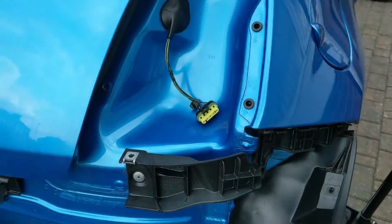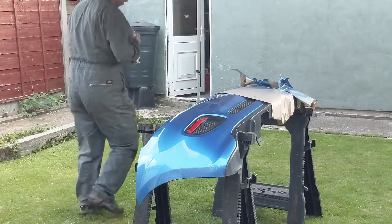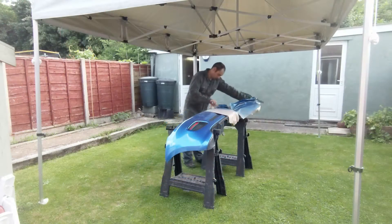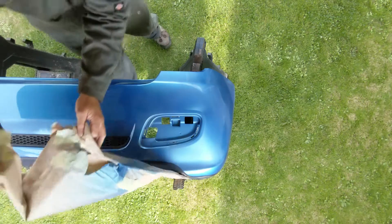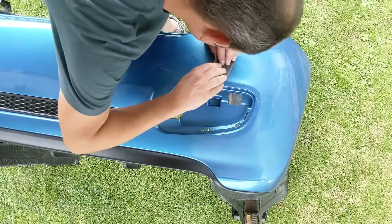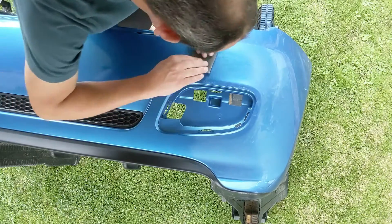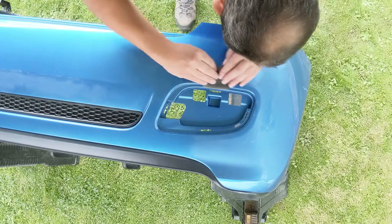As you can see that's looking much better already. Same behind the tail lights. Here we're applying the clear lacquer once the paint's had time to dry. After a few coats of clear we can then remove the masking. We're back out with a wet and dry, this time going with a much finer paper, lubricated with water. What we're doing here is a process known as flatting — when we've sprayed the lacquer on we've been left with quite a rough, speckled surface, so we use the wet and dry to try and flat that.